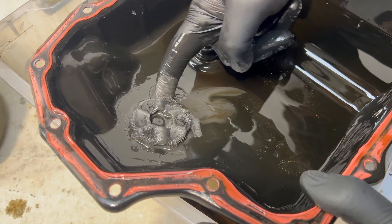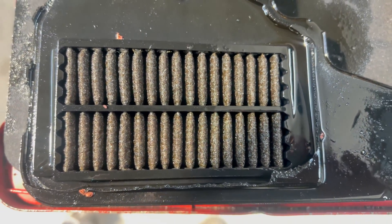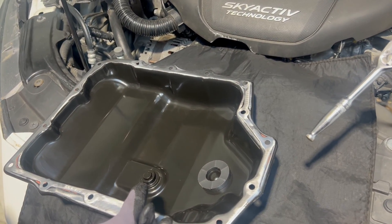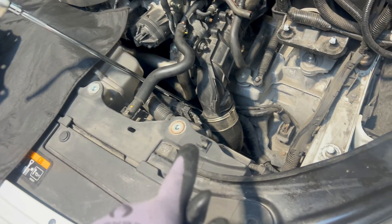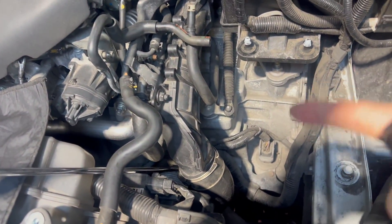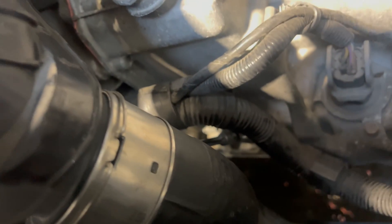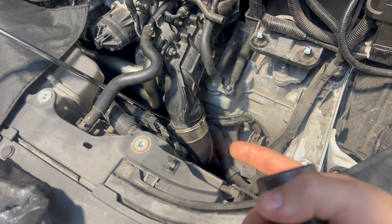Dan is enjoying himself. We've opened the old oil filter just for you to see. We've cleaned the oil pan — magnet cleaned. We're going to replace the washer on the drain plug. Dan is preparing the rubber gasket. We've also prepared a long extension with a ratchet for the transmission oil fill hole, which is down there behind the charge pipe. You undo a 10mm bolt, then you can pull the dipstick to check the level and also fill from that same hole.